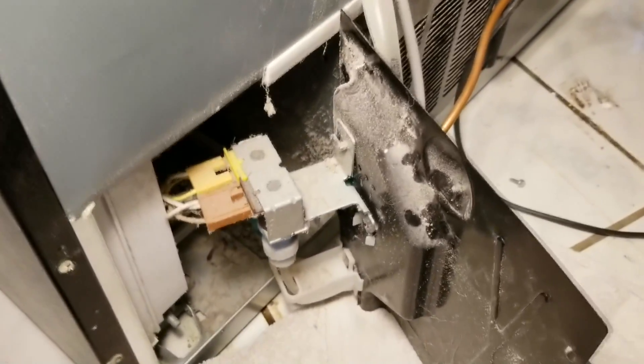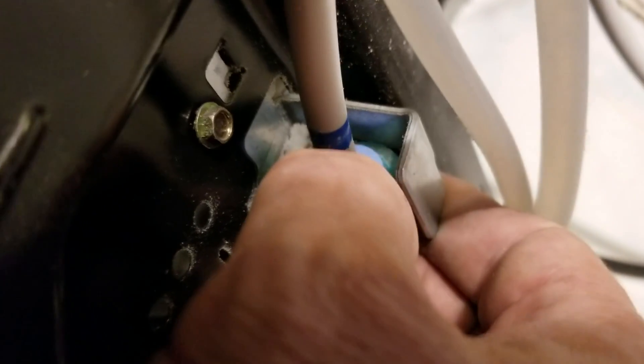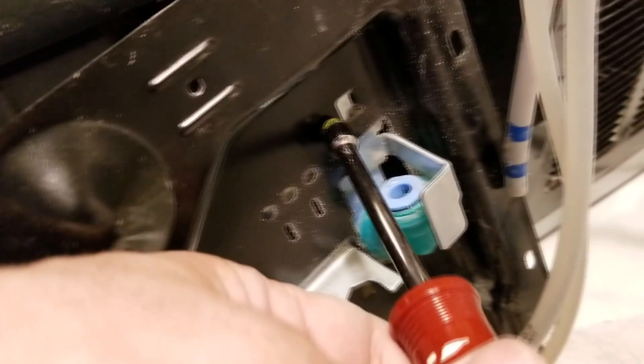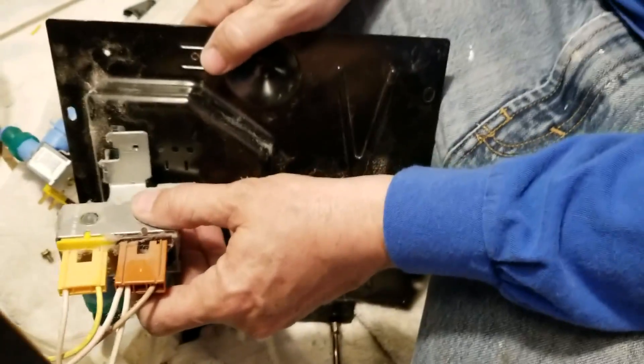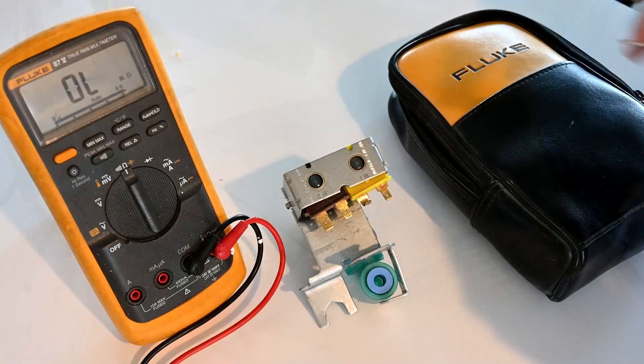Now that it's open, you have to unplug both connectors — they're color-coded for you. Pull off the retaining clip to separate the hoses from the hex opening. Pull this hose out by pushing down on the blue disc to loosen it, then pull the hose out all the way. Then loosen this last hex nut, which is securing the inlet valve apparatus to the back chassis. Then take the old apparatus off the rear plate.